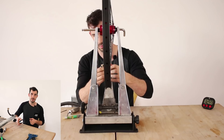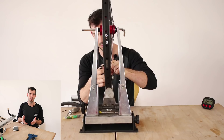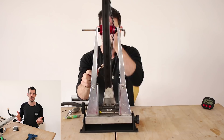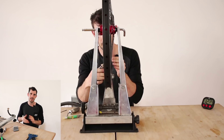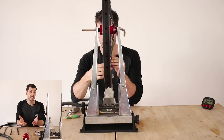Phil Rosetti asked why I don't use nipple washers. I've never really found I needed them. Some people say carbon fiber against aluminium can cause the aluminium to corrode, so nipple washers are probably worth using there. But for normal wheels with brass nipples, if you're building the wheel properly — stressing it and letting the nipples unwind — I don't think it makes that much difference.